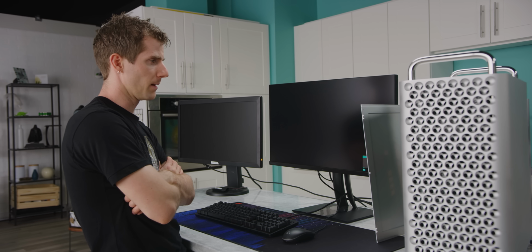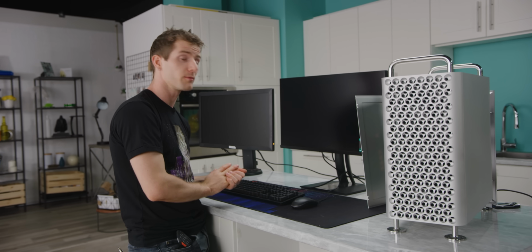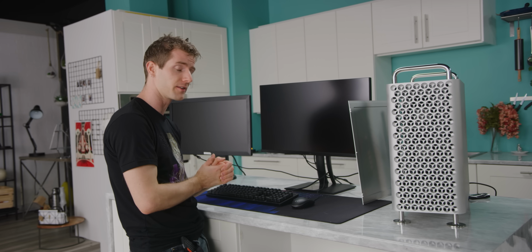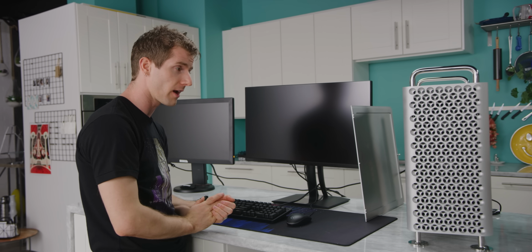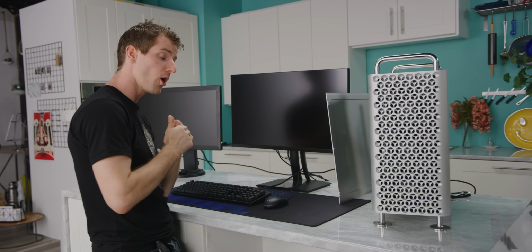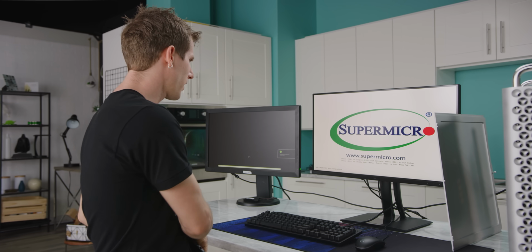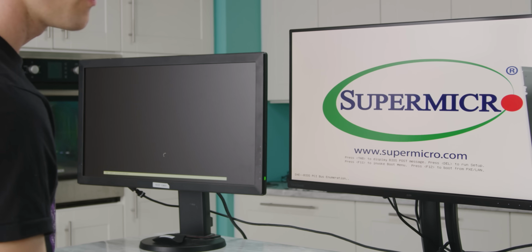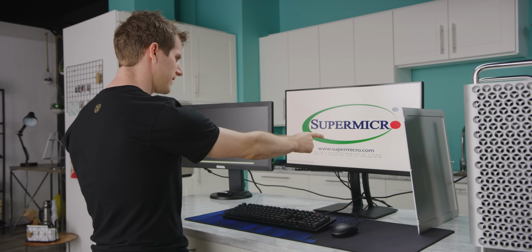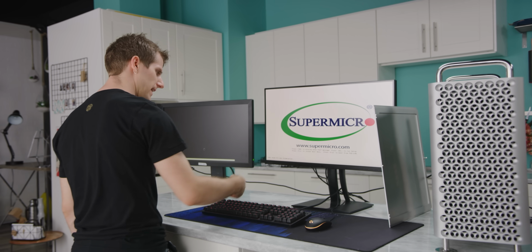success booting this thing up, but I grabbed a second monitor, plugged it into the onboard VGA port, and we did manage to get into Windows. There was a setting in the BIOS that said it was preferring its onboard graphics versus discrete graphics. I toggled that to discrete, so hopefully we're gonna get some kind of signal on here in a moment. Wait, hold on a second, what's going on? What? Why is it using the onboard again? So my Radeon 5700 XT is just stuck on this frozen splash screen,